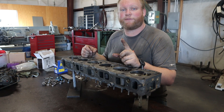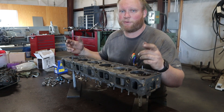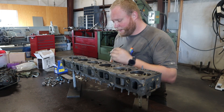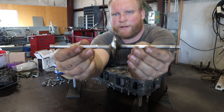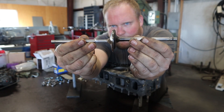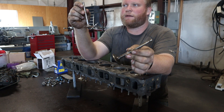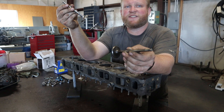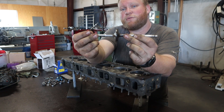The first big thing is bigger valves — engines are an air pump, so more air means more fuel, more bang, and so on. Here's the original valve, and here's the new valve. The new one is 200 thousandths bigger. This original one is one and three-quarters, and the new one measures 1.94 — just over 15/16ths. 200 thousandths bigger is a huge difference.